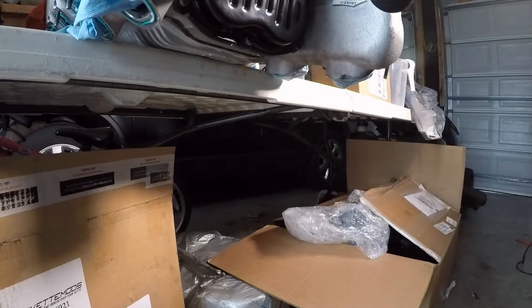As I mentioned in previous videos, GM treats these superchargers as a non-serviceable unit, so you're not going to find information in the service manuals about oil changes or things like that. You're going to have to refer to other resources. One resource I'd recommend is Superchargers Online — they do have some basic information about supercharger maintenance, and they recommend changing the oil every 100,000 miles.